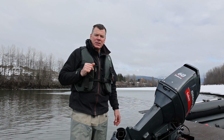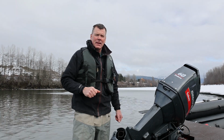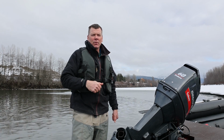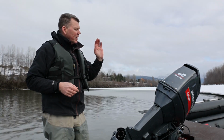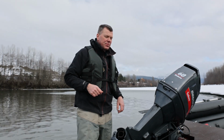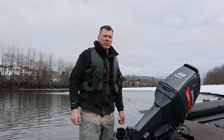So if you look at the Outboard Jets information, it says that you can actually move these fins, bend them about 1.5 millimeters to the right, to the starboard side, to counter that effect. I'll show you a couple of videos of just how I can't even take my hands off the throttle, off the tiller handle, and it really wants to crank the boat to the right.